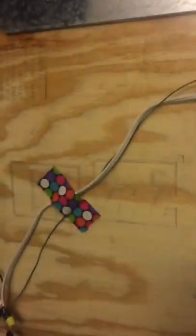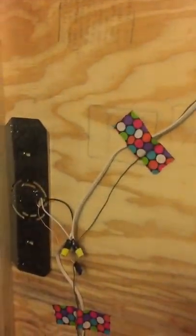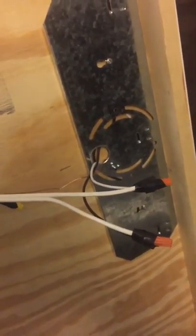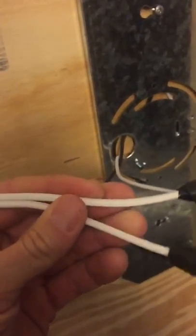Now let's talk about the wiring. The duct tape is just holding the wires in place so they're not dangling. Off each light bar you get three wires: white, black, and a ground. To tie the three lights together, you can loop them all, which is what I did. I used a cheap two-prong extension cord cut into pieces — about a dollar fifty-eight at Lowe's for a 16-foot cable. Both wires on the extension cord appear white, so you need to identify them.